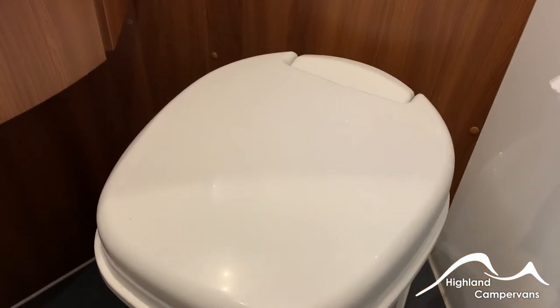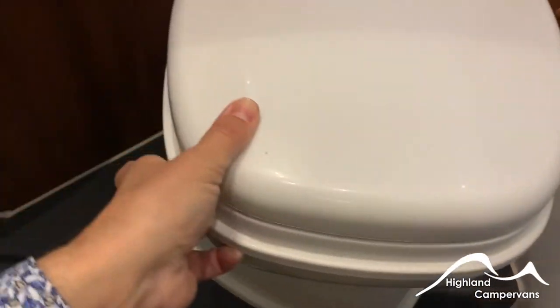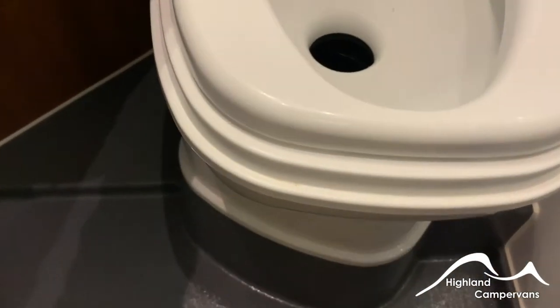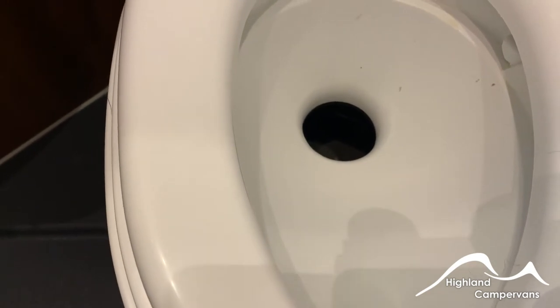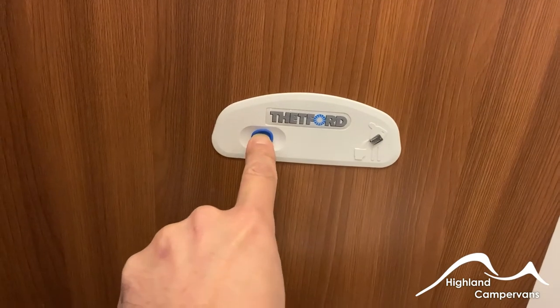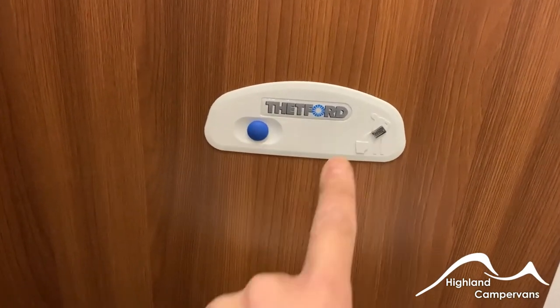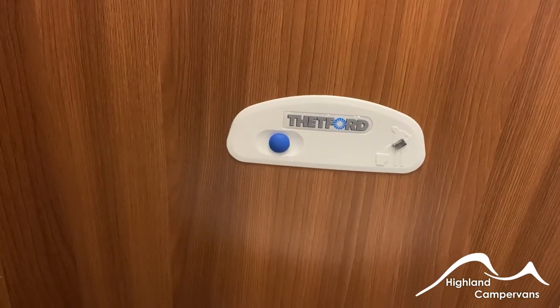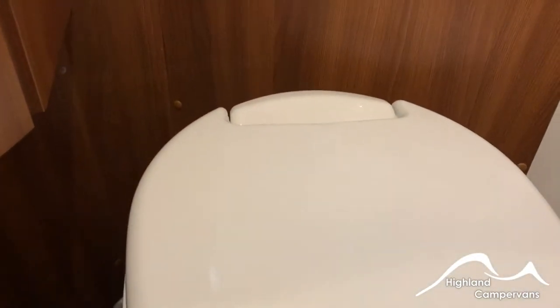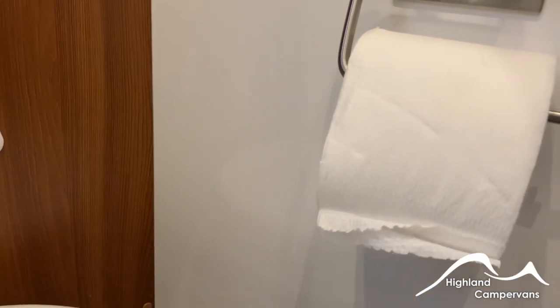Moving inside to your toilet — there's a swivel bolt action on the main bowl itself. To the right hand side of the bowl you've got a 12 volt lever. Before you use the toilet, bring that lever forward and it allows the main wastegate to open into the bottom of the bowl. Let your waste go straight through, then to flush press the blue button at the back — it takes a direct feed from your fresh water supply. When the cassette is approaching full you'll see an indicator light come on. After use push the slider back to close it off. Use toilet paper designed for chemical tanks — domestic toilet paper can lead to clogging.